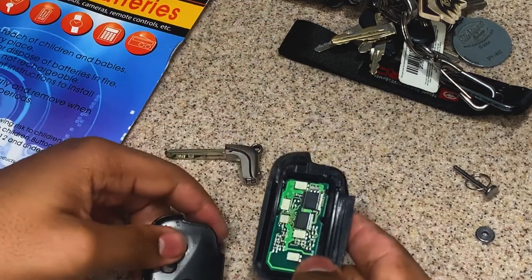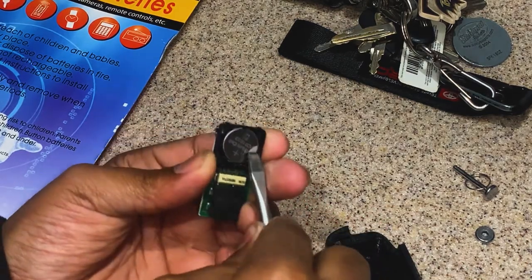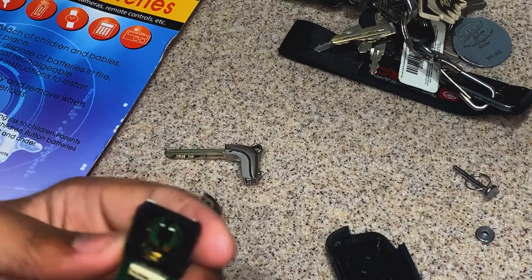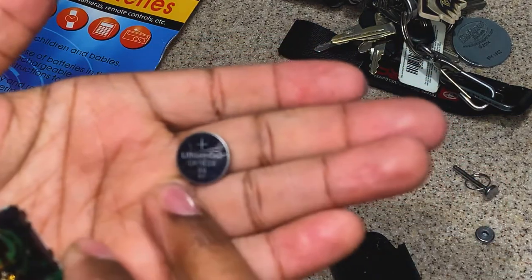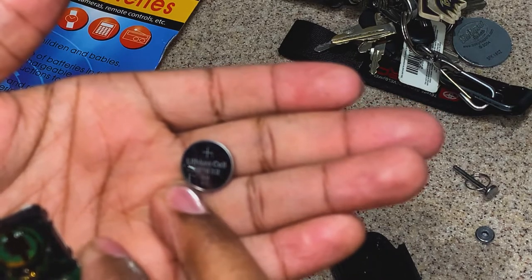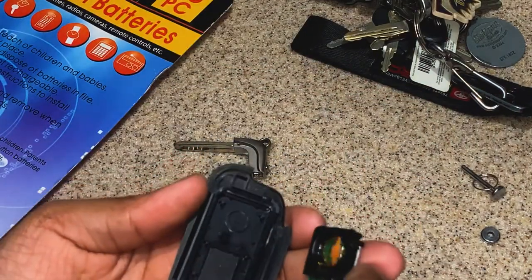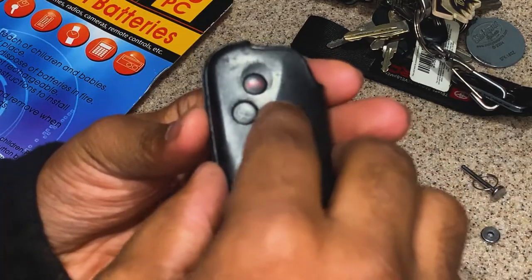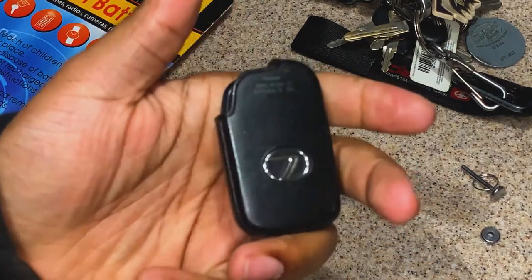Be sure to note exactly how your setup is. We're going to go ahead and remove this battery here. I highly recommend that you use a smaller flathead screwdriver so that way you don't damage the inside. I'm going to show you guys how to start your vehicle without a battery. The battery type is CR1632 — again, CR1632. I'm just doing this without the battery to show you guys how to start your vehicle without it. So we're going to make believe the battery is still in here but it's completely dead. Now we're going to go ahead and close the housing. Housing is closed — now let's go to our vehicle.